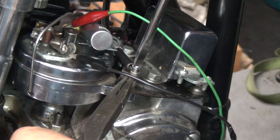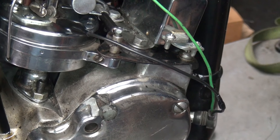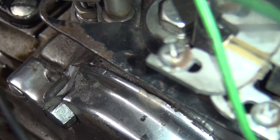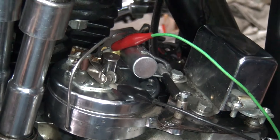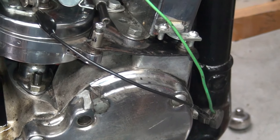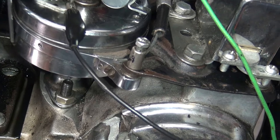Okay, right there — does it move now when I do this? Yeah, it moves a little bit. I've got tension on it. So when you pull the lever back there, it pulls this even tighter against this stop here. So it's fully advanced and in a good hard location. And that's important with these knuckleheads, huh? Well, with anything, you want to make sure you've got it fully advanced so it's not floating around. How far back does it go? You have full adjustment here — you went all the way to full retard. So you have plenty of travel in your system.